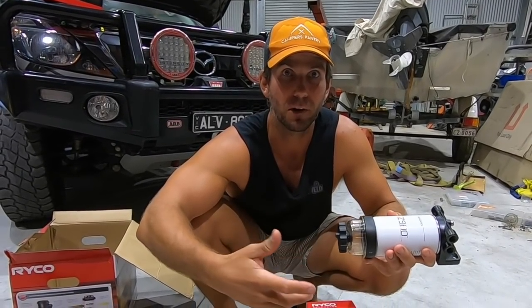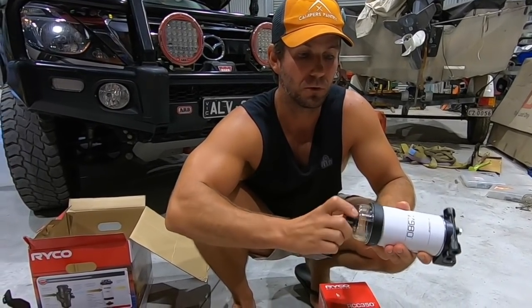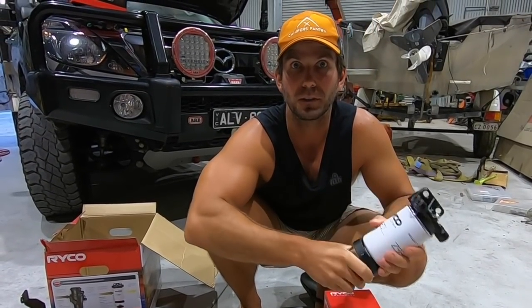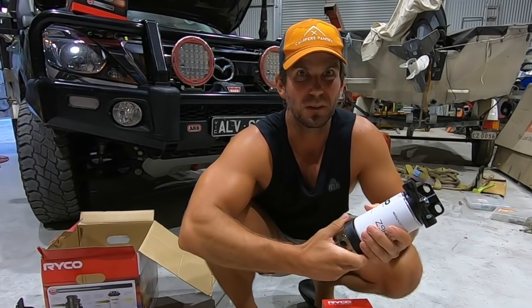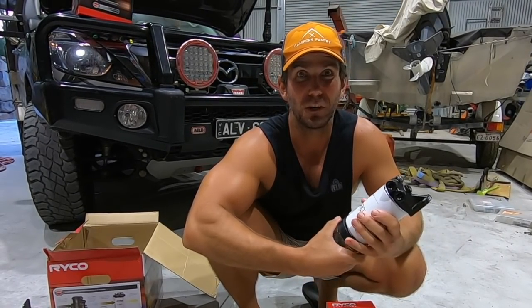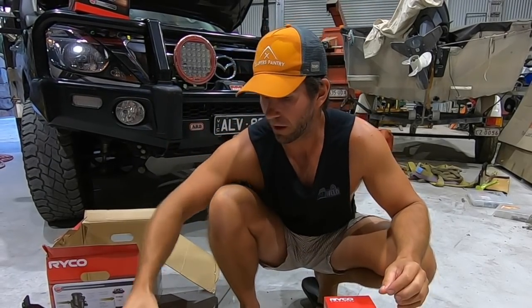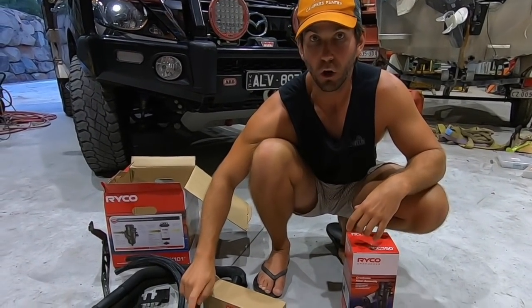So it's just an extra line of defense if you pick up dirty fuel and stuff like that, because, well, I know modern engines have fine tolerance injectors, and they're running high boost and they're sort of wringing the neck out of them. If you get dirty fuel, you can do a lot of damage. So pretty safe to chuck another one of those in, and you can pick up on any early bad fuel if you get it.